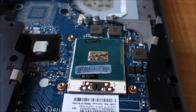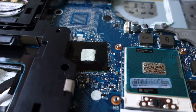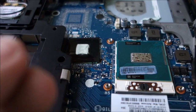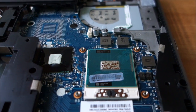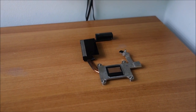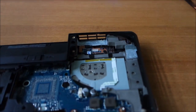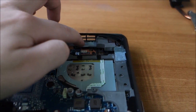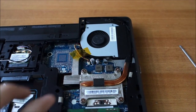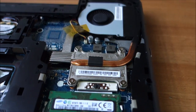The thermal paste is applied. I've managed to repair this heat pad. It seems it is something that basically glues itself together, so I'm going to reuse it. I've already tested this heatsink. I couldn't find the right name, and it fits perfectly even with this strengthening in. So yeah, let's do this. The cooler is in. The pad got squished, that means it is working.